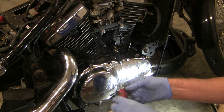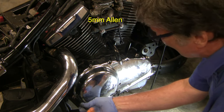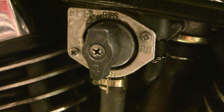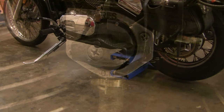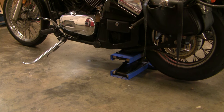This is blue Loctite for the bolts. The torque spec on these cover bolts is 95 inch-pounds, so not all that tight. Once you get it all back together again, you're going to want to prime the bowl of the carb — just shift to prime, that'll siphon fuel into the bowl and allow you to start a little more easily. I've got the rear wheel off the ground with a jack because my clutch isn't necessarily adjusted and I don't want the starter motor to cause the bike to jump. I'll start it in neutral and then shift into gear to verify clutch adjustment.